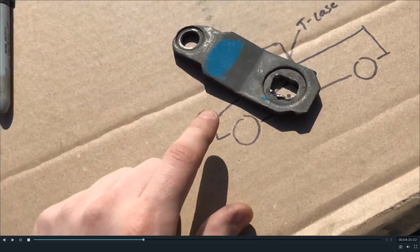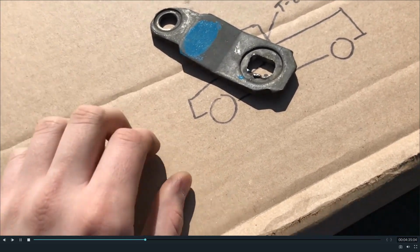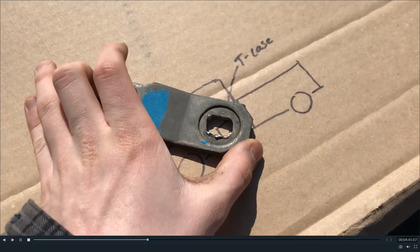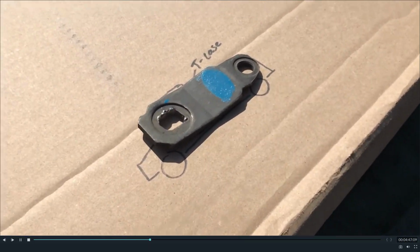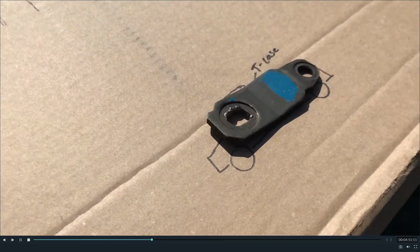And that's important because that means that it's possible to do this with a linear actuator. We weren't sure if that electric motor was going to make it go one way to four high and then back a bunch to low. We weren't sure, or if the motor made the peg turn all the way around for one shift. Yeah. Which I'm sure we could have just looked at an exploded view diagram and figured that out, but we're dumb.